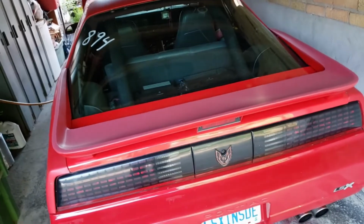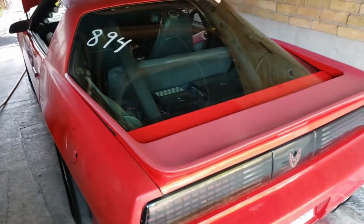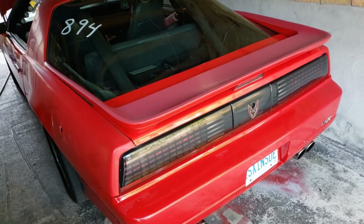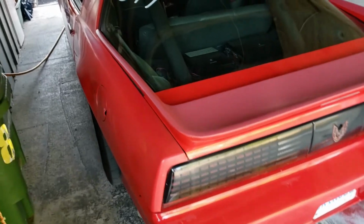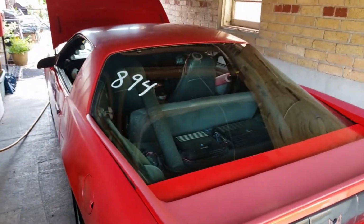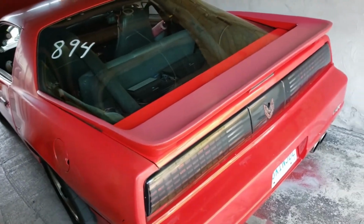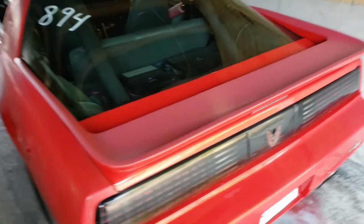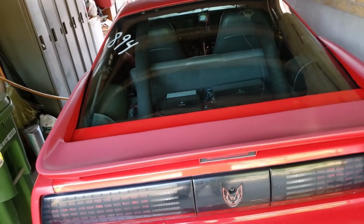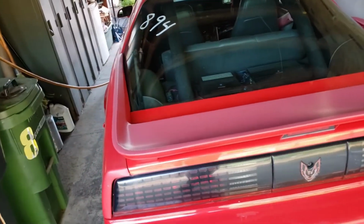After a long, disappointing day at the track, I'm home. Car just would not perform. Story of my life. But I think with the new lifters, I don't have the correct pushrod length. I have stock length, hardened pushrods from TSP in there now, but I don't think when I did the measurement that they're true. Top end, I'm losing tons of power, and it just sounds like valve float. So I think I need to just double check that.